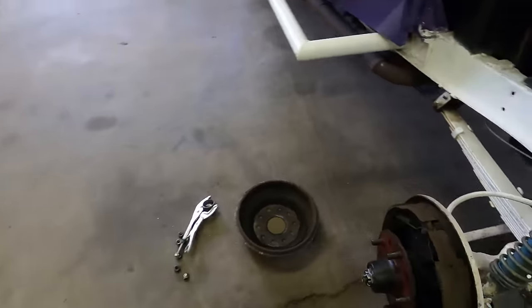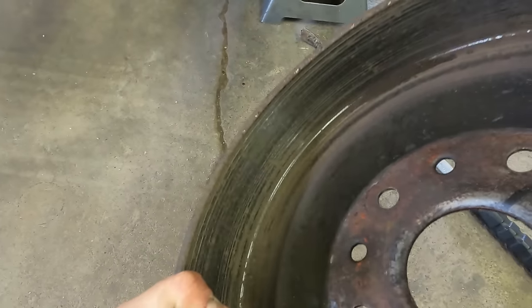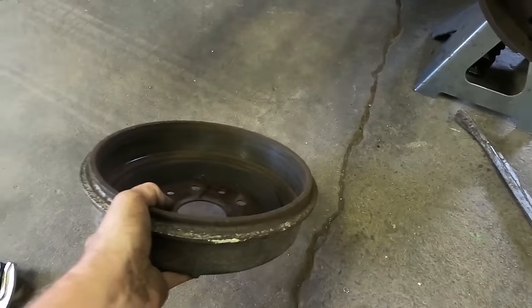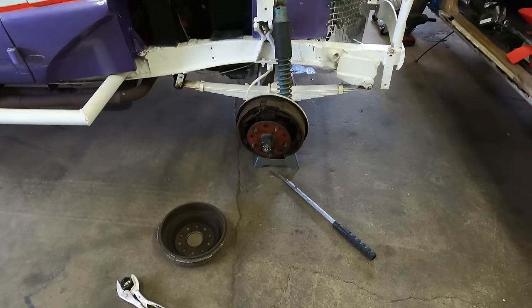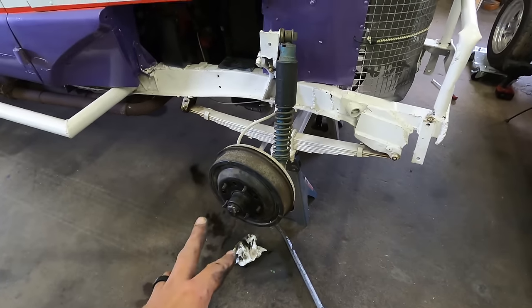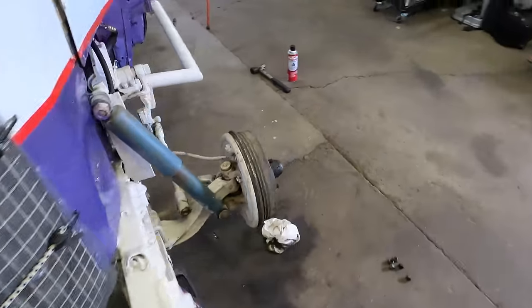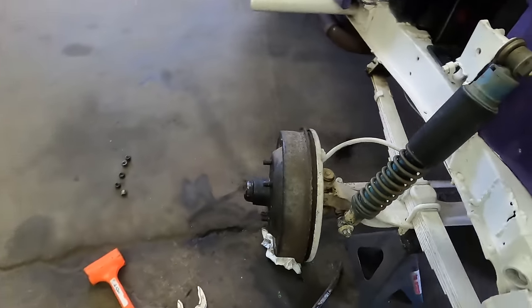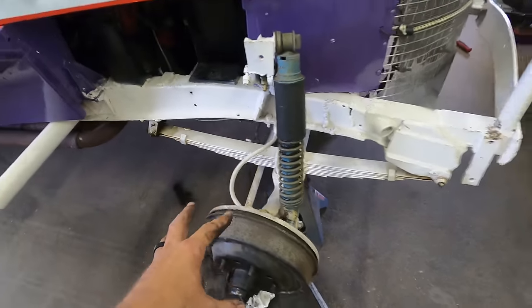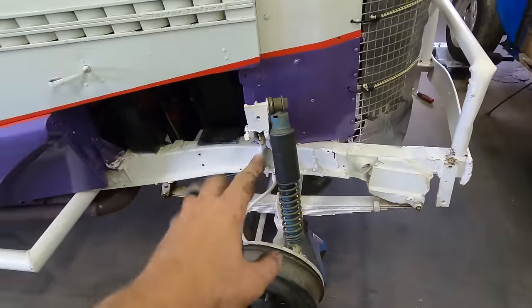Drinker side front — a lot of the same story. Shoes are okay, wheel cylinder looks fine, wheel bearing is A-okay. Except the drum on this side is shot. There's a lot of heavy pitting and some pretty deep grooves in it. So I'm going to do the right thing and just stick this back on for now, and then I'll just add it to my shopping list if a guy can find one of those. Now that a guy's hooked his peepers on it a little harder, I think the dust cap, the hub, and the brake drum are all different than the driver's side. I'm thinking that maybe all this has been updated at some point, which would make sense — this one's in a little worse shape, might be the elder. I also checked out the pins and everything else, and I think the front's about as good as it's going to get. We'll just ignore this stuff for now — it's worked for 60 years, it's fine.